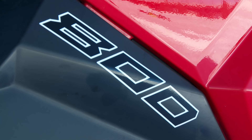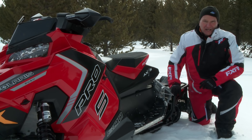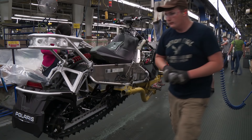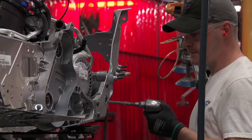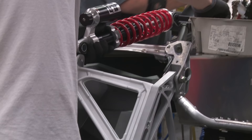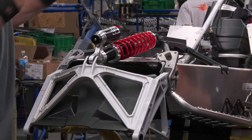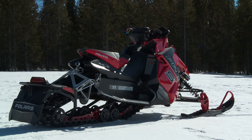The AXIS chassis employed a deliberate, thorough, and intentional weight reduction program which netted an impressive 35-pound slimming over the former ProRide chassis. This win-win reduction came with improved chassis stiffness and improved overall durability. Watching the AXIS being assembled in Roseau last summer was a revelation. The front clip is assembled from castings, extruded aluminum, and carbon fiber. The old handle-pull-over structure, which pushed the ProRide center of gravity up, is gone, and a simplified K-brace now serves as the rear shock mount. The AXIS chassis is a remarkable accomplishment because it's not only lighter — it's way stronger.